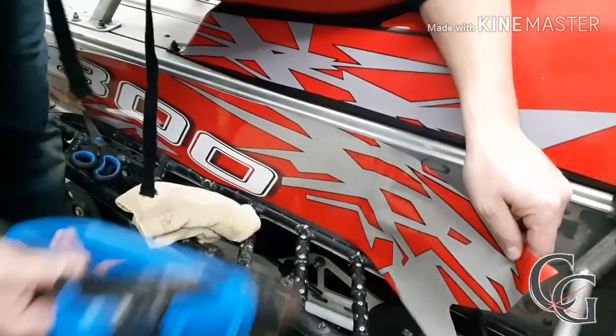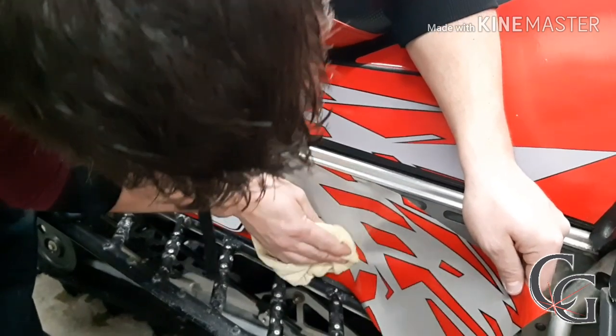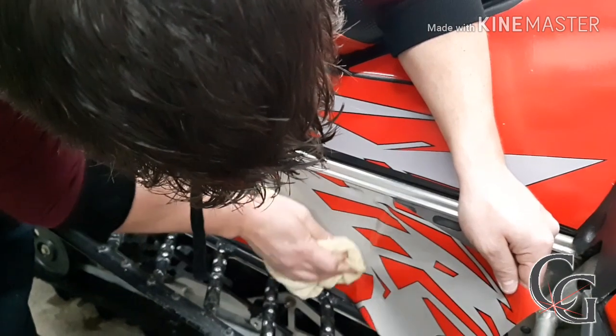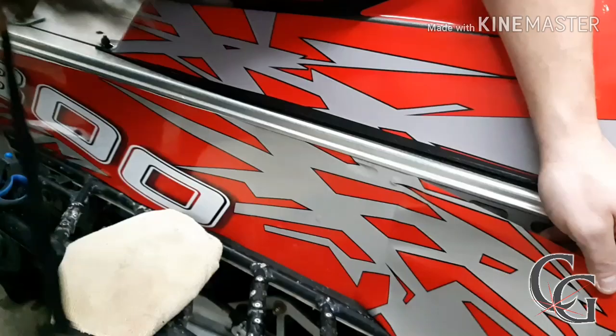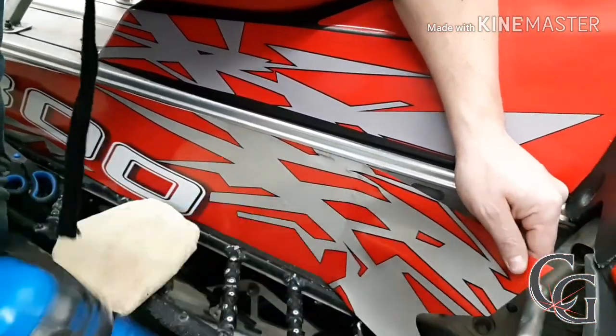You can see it gets really, really soft here. So you're just going to knock off a finger width at a time, maybe a quarter inch at a time. When you get to rivets, you can see what happens — it just conforms right around that rivet real nice. You wouldn't be able to achieve this with a squeegee.